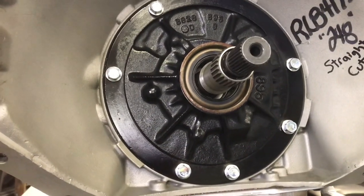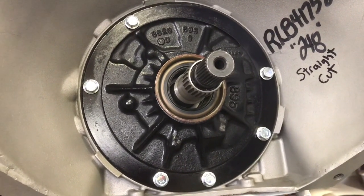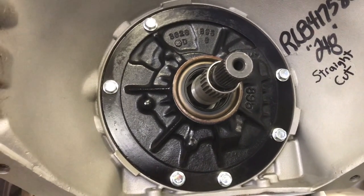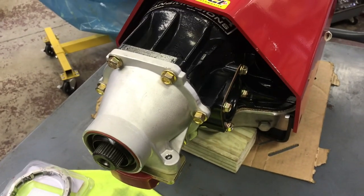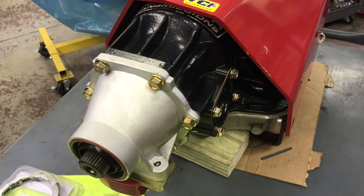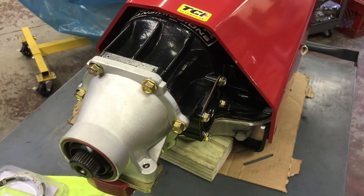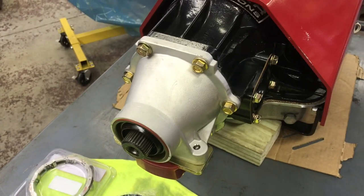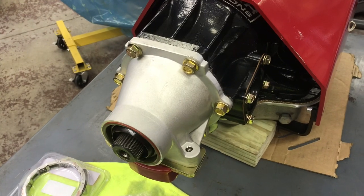This case is a six-bolt case and there's no need to change it right now — as far as just holding the pump into the case, we're not talking about adding a bell housing, so it functions just fine. I bought this tail housing because every rear bushing I install, I end up having to hone it for the yoke to fit. I was glad when I bought this FTI unit and the yoke fits right out of the box — that's awesome.